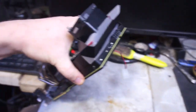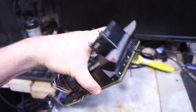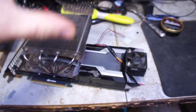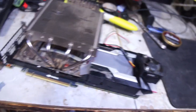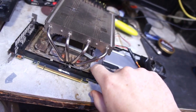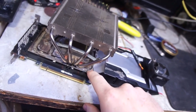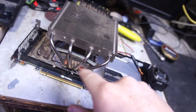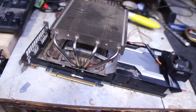I bent up some plastic for a shroud to direct all the air. I pull what's left of this shroud off and the fan comes off with it. There's a duct here that directs the air down — I want to try to get it between the cold plate and the base plate to help with the VRAM temps, because those aren't great.